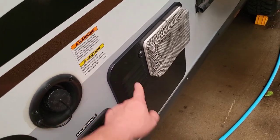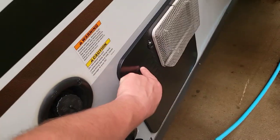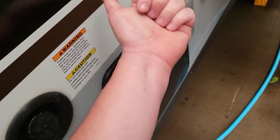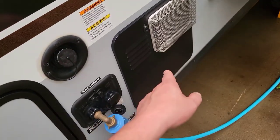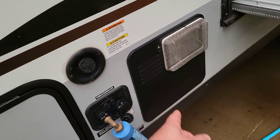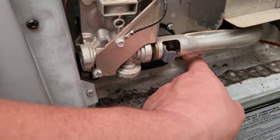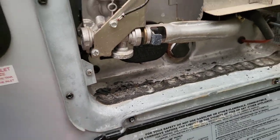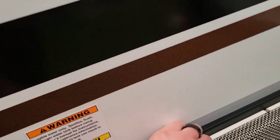Close your two valves — top and bottom — on the inside, to the back side of your water heater. You don't want to run antifreeze through the water heater. Also, to winterize it you have to pull the anode rod out — this little guy here. I'll put the socket sizes you'll need in the link below. Keep those on board.